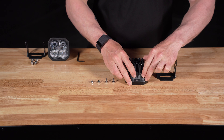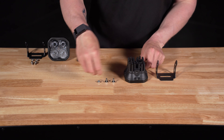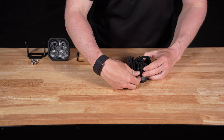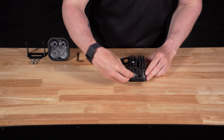Now we're ready to assemble our SS3s. Drop the supplied nuts into the slots on the sides of the pod with the nylon ring facing the inside. Then slide the universal bracket over the back of the pod and thread in our 5/32" Allen screws and washers, leaving them hand tight to save room for adjustment later.